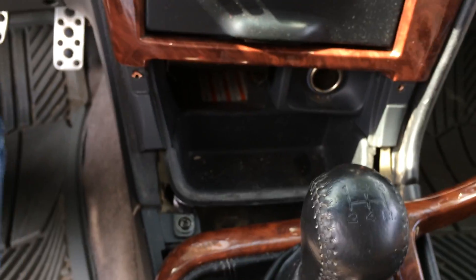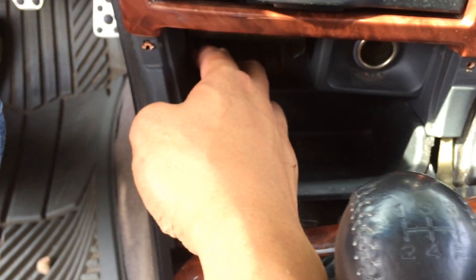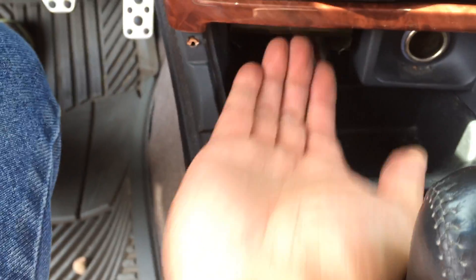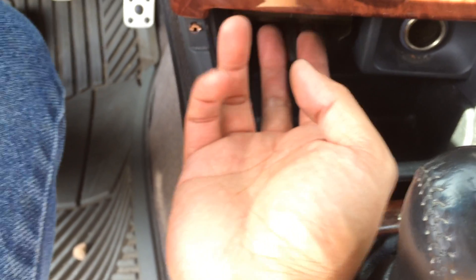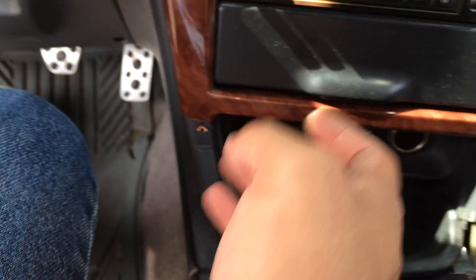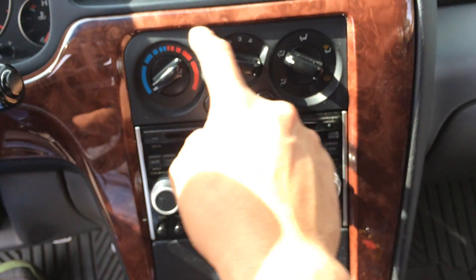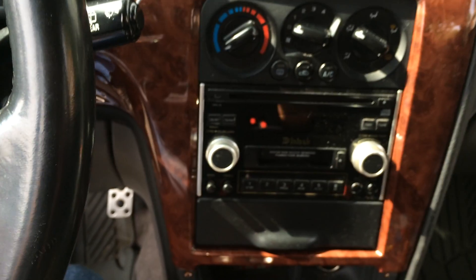After that comes out, what you would do is put your hand under here on the left and right side and pull towards you. The piece that was holding the ashtray will fall down, and then this will allow you to pull this whole cover off, including here, and that's all — and from behind there.